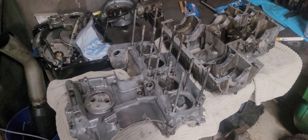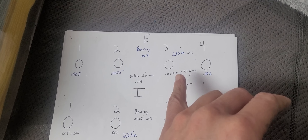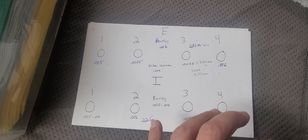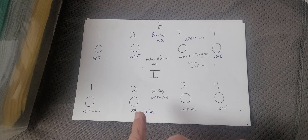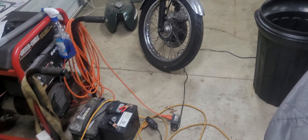I've got the cylinder head all done and I'm waiting on one shim. I went through and checked all my valve clearances — this exhaust valve only has two and a half thousandths clearance, and I'm looking for four to six thousandths, so I ordered a new shim for that. Otherwise all the other valves are within spec. I'd be a little happier if I was at four to five thousandths on some of them, but six thousandths will be okay. I may go back before assembly and swap a shim on a couple of others — I've got a couple weeks before I need to decide.